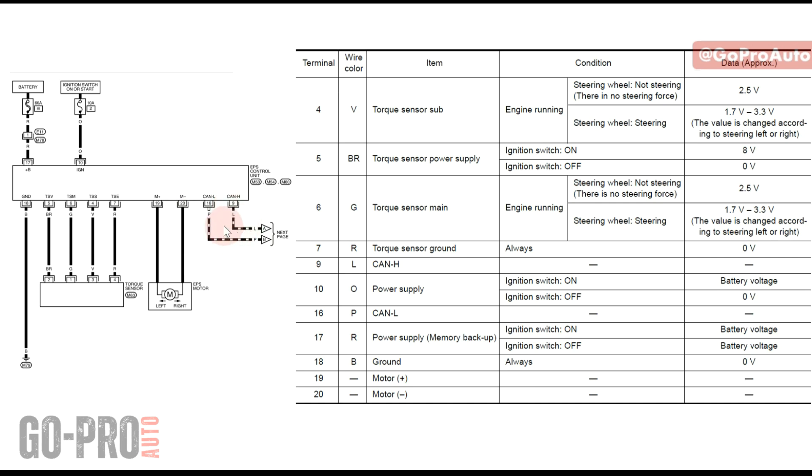These two wires are CAN bus high and CAN bus low for the high-speed CAN. There's another video on the channel — you can find the link in the description. Diagnosing the CAN bus is completely different, and if you have a problem on the CAN bus it might be reflected on other systems too.